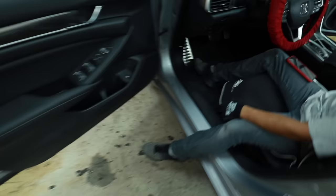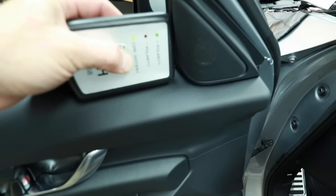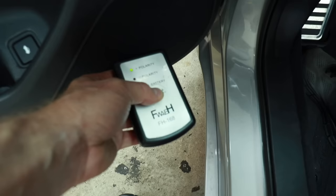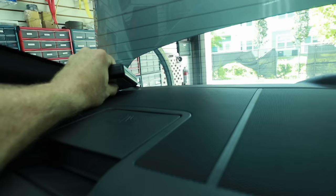Go ahead and play the test track — the speaker is going to make a popping sound. We put our tester to it and this track puts out a green-green-red pop, which we're seeing here. Tweeter is doing green-green-red. Mid-base is also doing green-green-red. We'll check the rear of the car — check the far tweeter. Now that we've done that check, we know that all the speakers in the car — tweeters and midrange — are all moving in the same direction, nothing reversed relative to its counterpart. Knowing that information at the beginning saves us time at the end.